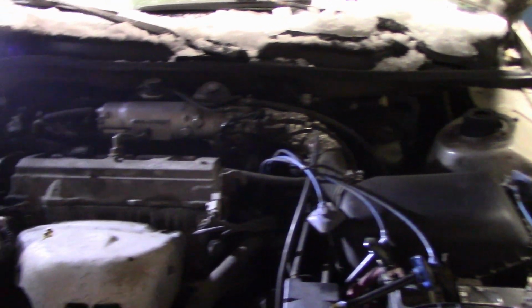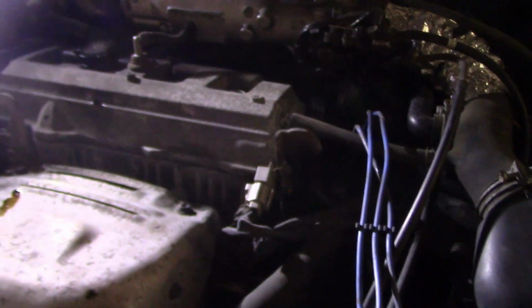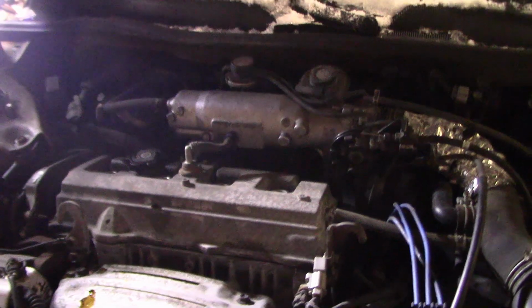So today, on maintaining your Toyota, what we're going to be doing is a valve cover gasket. We've already gone ahead and unplugged the spark plugs. Now the secret to this: they're all different lengths, so when you unplug them, they can only go back one way. Longest goes to the longest hole. 1, 2, 3, and 4 we disconnected because it was in the way. But yeah, I couldn't pull it out of the hole.